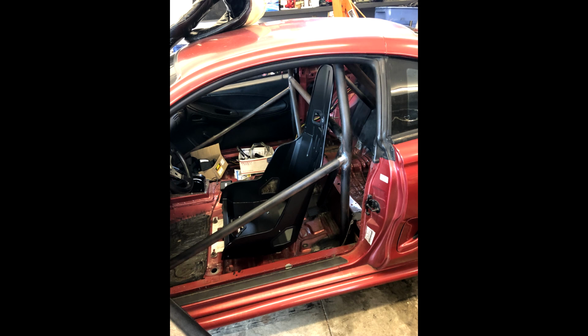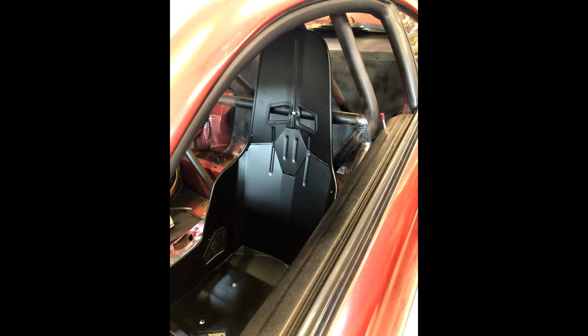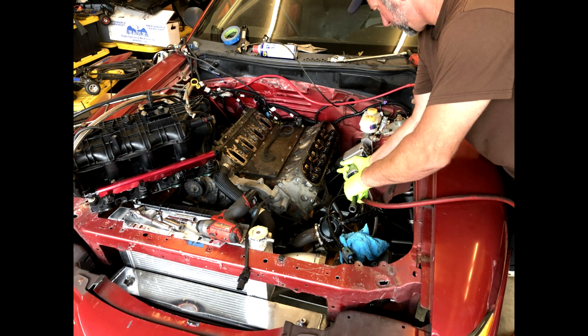So as you guys can see here, we splurged for the $130, $140 Jegs powder coated black seat to make the car safer and more comfortable, and use the belts we already have with the car. It came with 5 points, but it came with plastic tractor seats or something. So we stuffed these in there, and I just wanted to show pictures of what Mark did. They tied it into 4 points in the floor and 1 point to the roll bar, and we're welding the tabs in to do the 5-point harness, to make everything legal and safe, obviously.